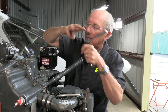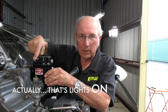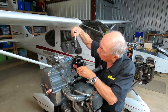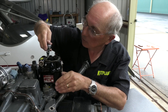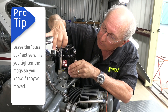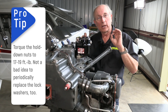You can see the range of motion available on the magneto to adjust timing — that's way more than you're ever going to need to use. Once you have those loosened up and your buzz box going, make this move just a little bit until the lights go out. That tells you you're synchronized and lined up — assuming you've set your timing mark on the proper spot in the crankshaft rotation. Once you get it all lined up, gently tighten these nuts up. As you tighten them, they have a tendency to move the magneto a little bit, so alternate between the two and listen to your buzz box — if it changes tone, you know you've moved things. When everything is nice and snug and torqued back up, check the timing again by moving the prop and you'll find you've set your timing exactly where you want it.